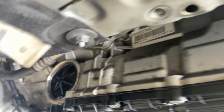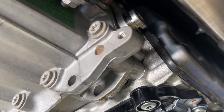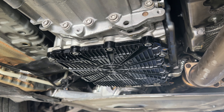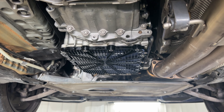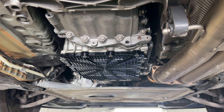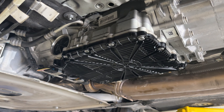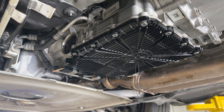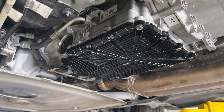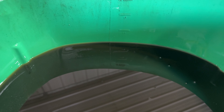Both filters are replaced — time to start the filling procedure. To fill the transmission, we remove the fill plug we loosened earlier and fill it with fluid until fluid starts coming out. Then we put the fill plug back in, start the car, and hold it at 2000 rpm for one minute. By that time the transmission fluid temperature should be above 32 degrees Celsius. We then remove the fill plug again and top the fluid off until it starts coming out — all of this has to happen after it hits 32°C but before it reaches 40°C. The fluid we drained out was definitely more than five quarts, probably about six, so we know we'll need at least that much.